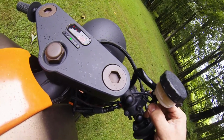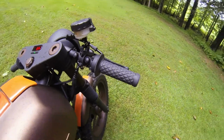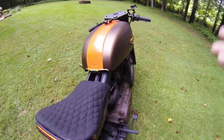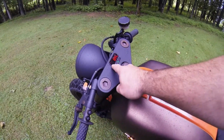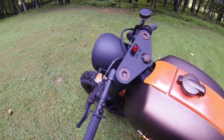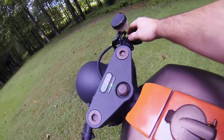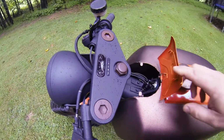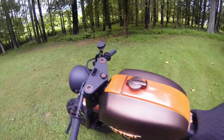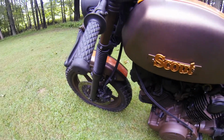That's another thing. It's an electronic speed sensor, a magnet on the wheel. I have it roughly set, but that's the reason I need to get it on the road, to get this completely calibrated so the speed is accurate with the wheel diameter. When you program this, you use this button, which is hidden under here. Turn the system off.